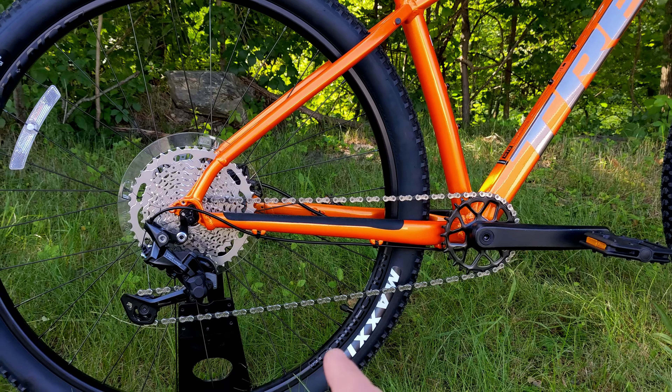The quieter operation comes from the clutch system on the Shimano Deore derailleur. Right now it's turned off, so you can see the derailleur cage bouncing around — that's what causes chain slap against the frame. Turning the clutch on tightens up the chain so it's not bouncing around, keeping everything much quieter compared to a 2x setup. You'd almost always run it with the clutch on, but they give you the option to turn it off when removing the wheel. It runs through a KMC chain to an aluminum 1x Pro Wheel C10Y crankset with a narrow-wide 30-tooth chainring, which has alternating thick and thin teeth to keep the chain from hopping off.